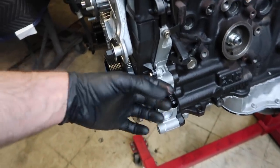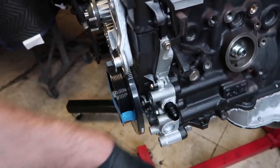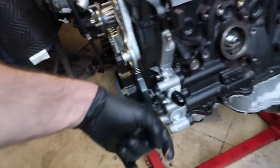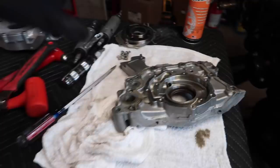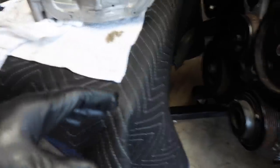This is what I would suggest if you're trying to get more flow or higher oil pressure. It'll do both, but then at the same time it'll do too much if you're running too high a weight of oil. It eliminates one of the 90s — oil just comes straight out of here and then flows through AN lines to your filter relocation, which is probably somewhere along your frame rail. We're going to walk over to TJ Hunt's car and I'll show you how we did that, then come back and talk about the different oil pump options.